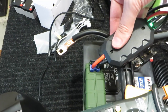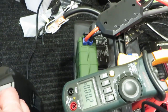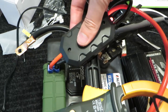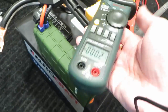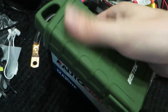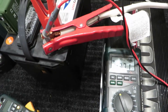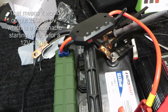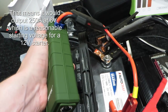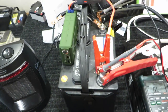That's almost burn-yourself hot inside this plastic case. But that's okay — it's really only meant for one use. I like how when you hook it up, it automatically turns on for about 30 seconds and then shuts off. And here you can see the red light — that means that it overheated, so it shut off. You can tell that it's very hot. But that should have been enough time for you to start your car. The actual pack here is also quite warm, downright hot in fact. But it did the job. Even at 12 volts at the battery — which when you're starting your car could go down to 6 volts — even at 12 volts, this thing put out 100 amps. So I'm actually quite impressed with this little guy.